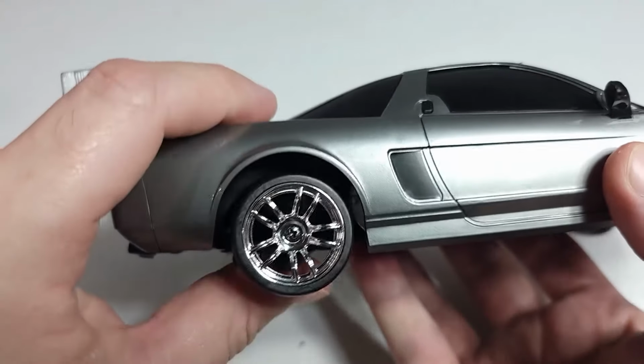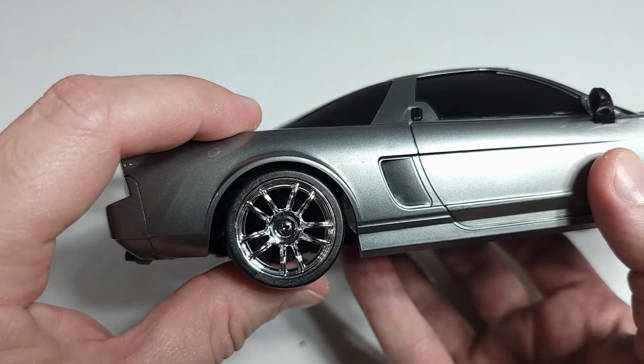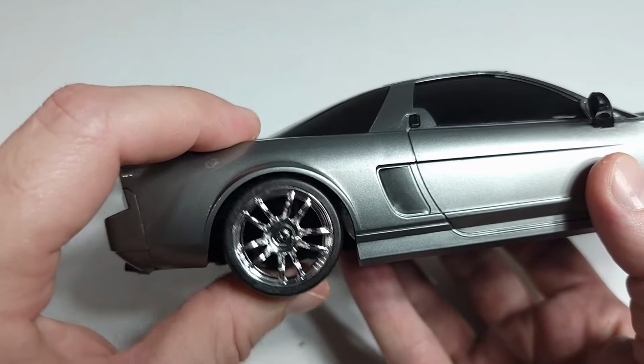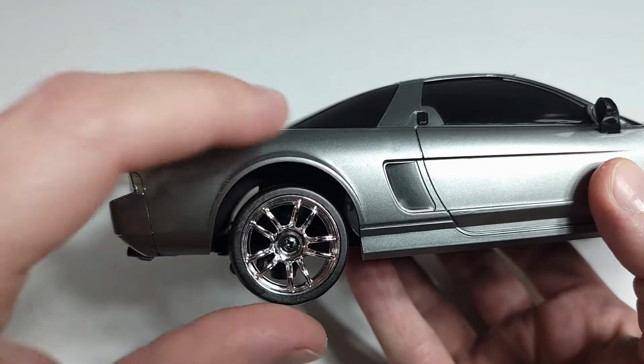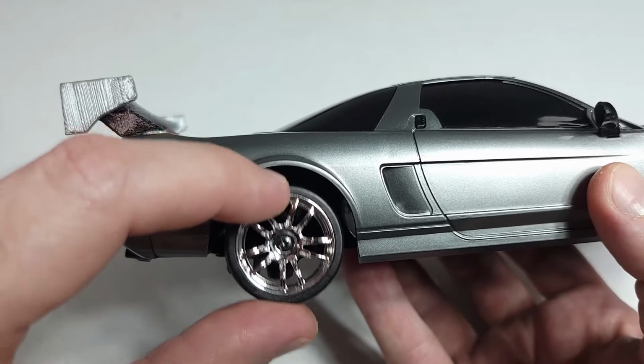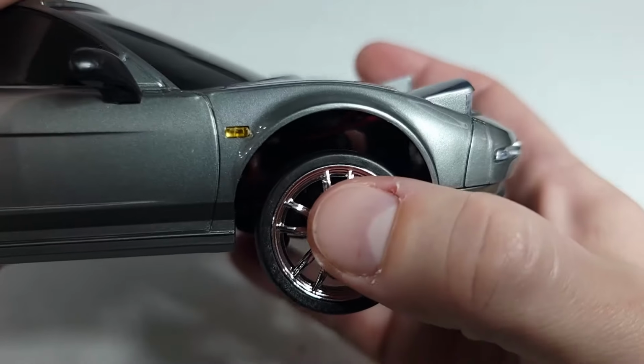But so yeah, the sag, see how the sag's down? That's what I want, but when it's sitting on the table, it'll be like that. And then I still have the amount of suspension I want, so when it bounces around, the wheel will try to make sure it's always making contact on the ground when it's bouncing up and down. Same with the front end.